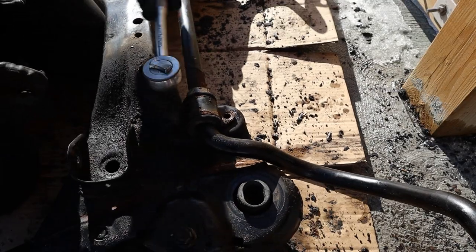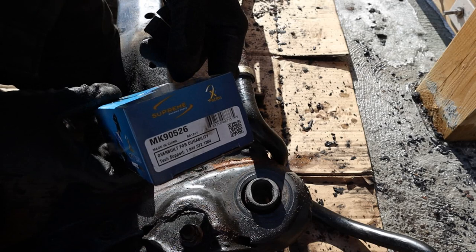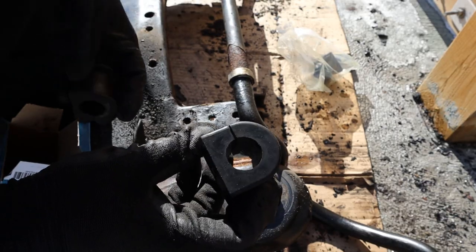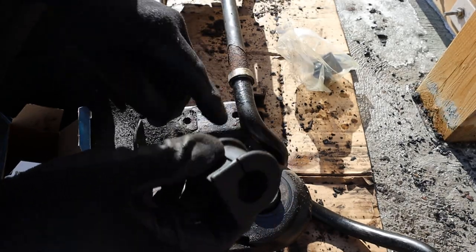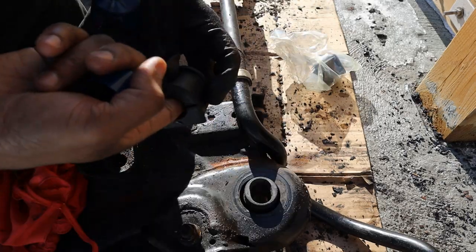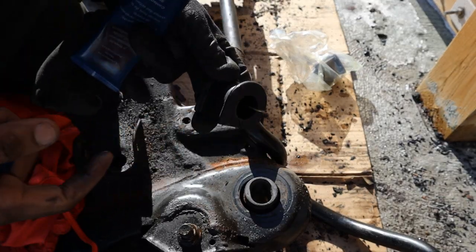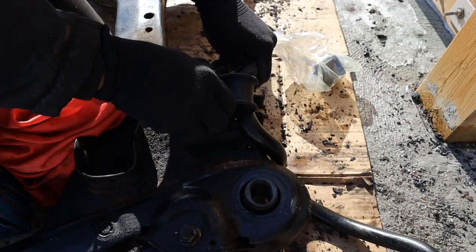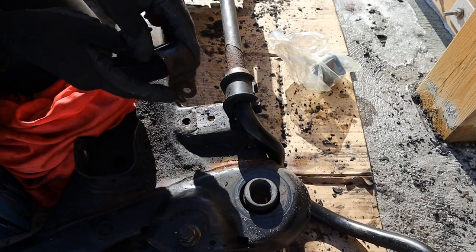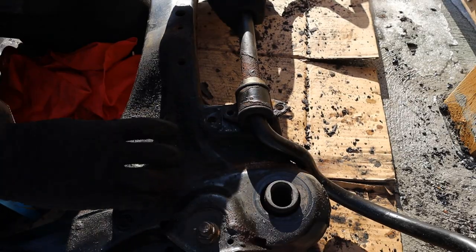These bolts are usually pretty difficult to get to while in the car. I am going to remove and replace the bushing there — I got these from MevoTech. The bushings come in a pack of two and are specific to the trim; the SE has a larger bar because it is for sportier handling. Add some grease to make sure things move nicely and don't squeak, then pop that bushing on. The caps have an arrow on them and have to point forward. Remember we have got to get the steering rack bolt in there, so we are going to mount that up next.